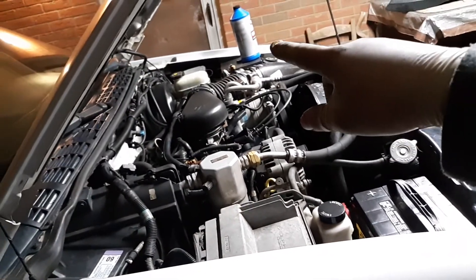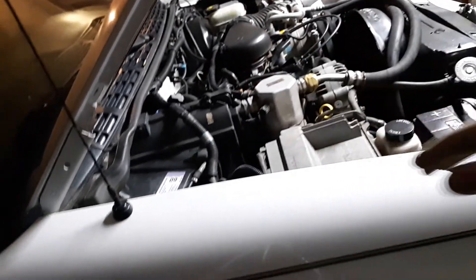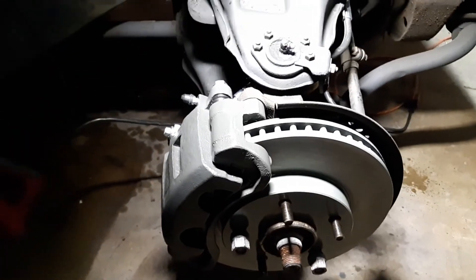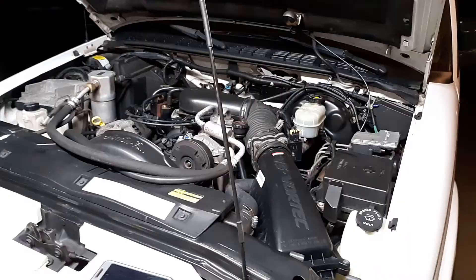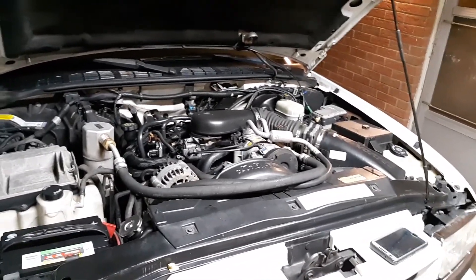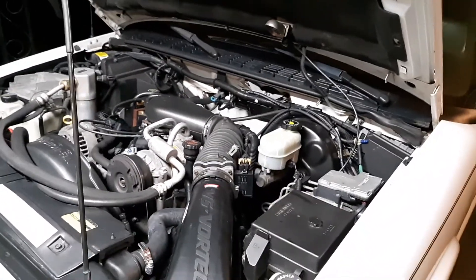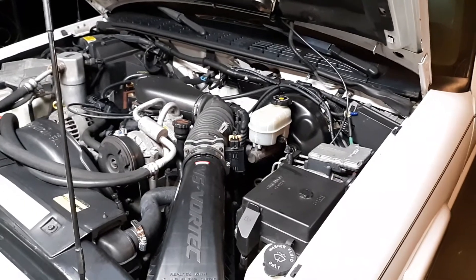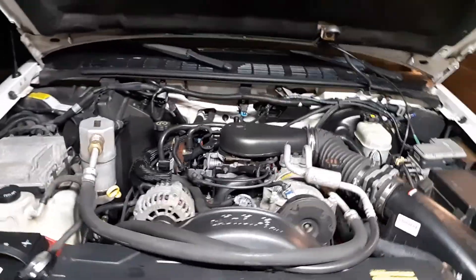After you do that a few times, pump it and make sure you've got brake fluid — I've got a whole container since I've done all four brakes on this thing. Fill the reservoir back up to where it needs to be. The wheel should still turn freely after all that — if it doesn't, something else is wrong. That pretty much does it for this repair. I hope this really helps — leave any tips or questions below, subscribe, and make sure you have the notification bell on. Thanks for watching!